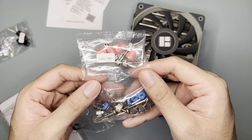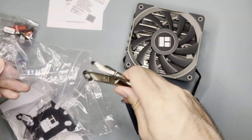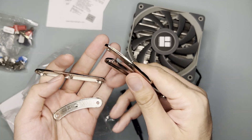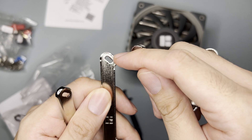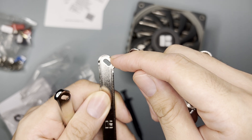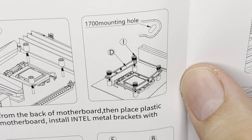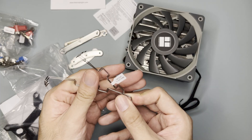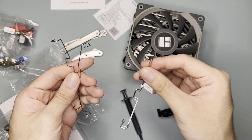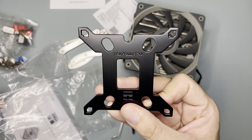Do note that this is AM5 compatible. It also has mounting screws for Intel, mounting brackets, and thermal paste. The Intel mounting bracket is compatible with LGA 115X and LGA 1700, with a specific mounting hole for LGA 1700 — verified in the manual. There are fan clips: one for slim fans and one for 25mm fans. And a back plate for LGA 115X, 1200, and 1700.